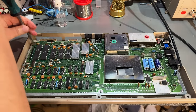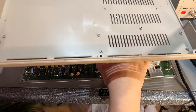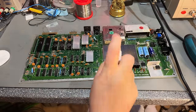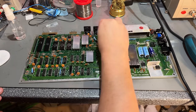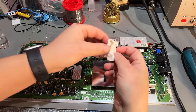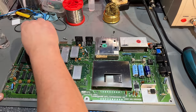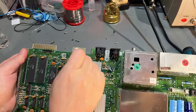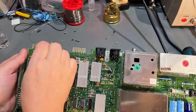The next thing I'm gonna do is clean off the motherboard — it's full of dust but otherwise looks alright. For the case I'll take it down and clean it in the sink, just a simple wipe-off, then go over the details with cotton swabs and some alcohol. I just like everything to be spotless. I use a regular drill to clean the contacts with some contact cleaner. The edge connector you can clean with a rubber eraser — it works very well. Don't use abrasive tools like a fiberglass pen because that removes the thin layer of gold on the edge connectors.